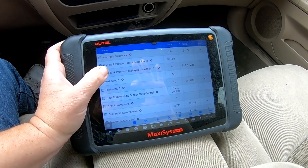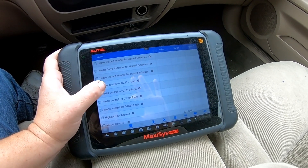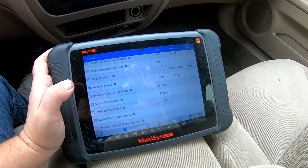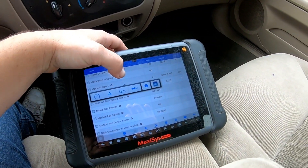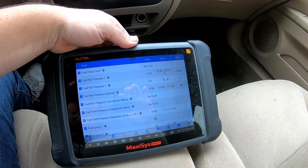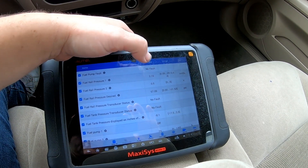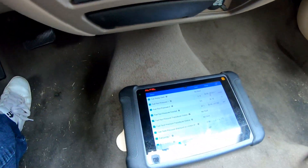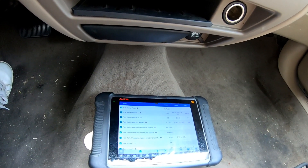What I'm going to do first: Ford took away the Schrader valve and replaced it with a fuel rail pressure sensor. This is basically a strain gauge device that uses engine vacuum. To diagnose this, I'm going to crank the vehicle and show you key-on engine-off fuel pressure, then fuel pressure while cranking. We'll figure out if it's the sensor, the fuel pump, the PCM, or a driver issue. When cranking, pay attention to the fuel rail pressure sensor reading versus the desired — it should be around 35 to 40 psi key on engine off.